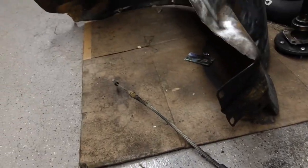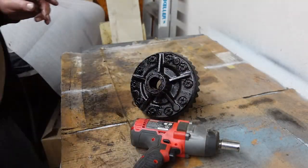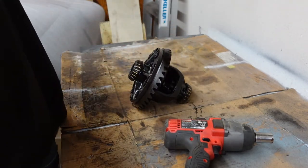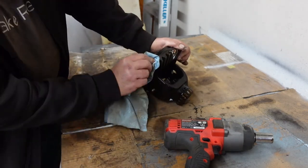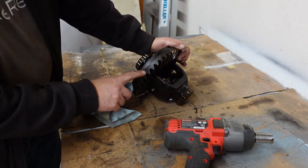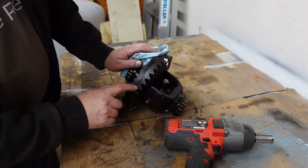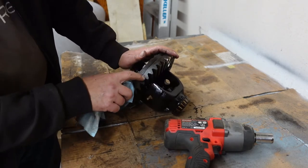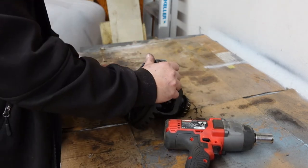I've been doing a lot of verifying today. If you pull your cover off, you can see your ring gear, and there will be numbers stamped on the ring gear. This one was stamped 3711. If you take 37 divided by 11, you get 3.36 — so that's the gear ratio that's in this. And I'm actually going to stick with that.